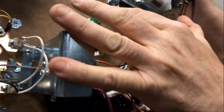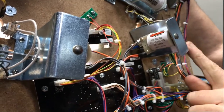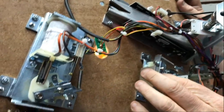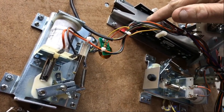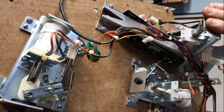The slingshots, if you're familiar with the slingshots, are almost identical going back to the old Data East ones with the angled metal. But they usually had another switch, so they're slightly different from the original ones. The flipper mechs are the regular commercial grade with the big fat screws, so the flippers are identical. And I'm willing to bet that the optic boards are identical. The early kicker is probably identical. Yep.